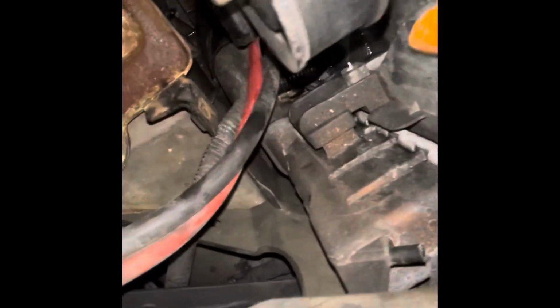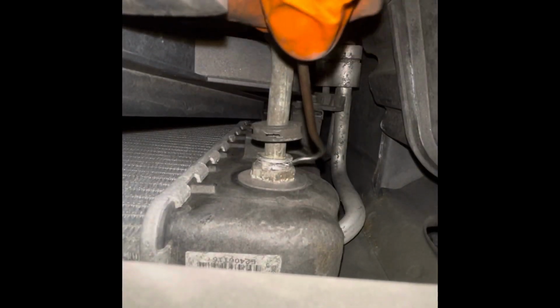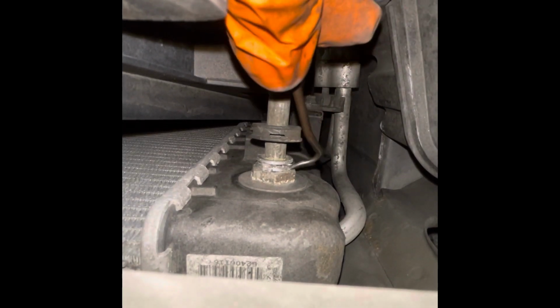And now we can start to remove the fan assembly. So what it is, those bolts we took out, and then on the bottom part, like down right there, it hooks on. So if you look and just pick it up, it unhooks just like that on both sides. So just lift, and we wiggle it on out of there. We have this part here getting stuck on this transmission line. That's where this lovely pick comes in handy. Just like that. Just get it on out.